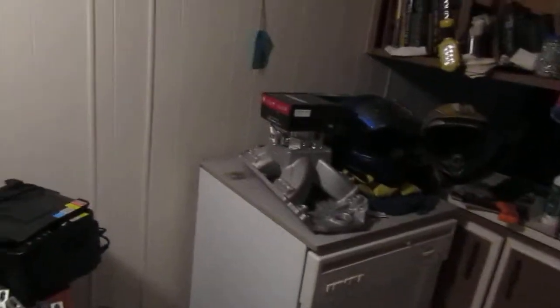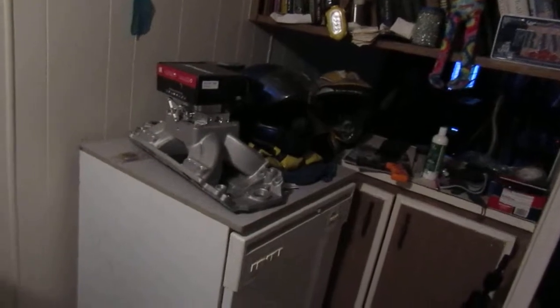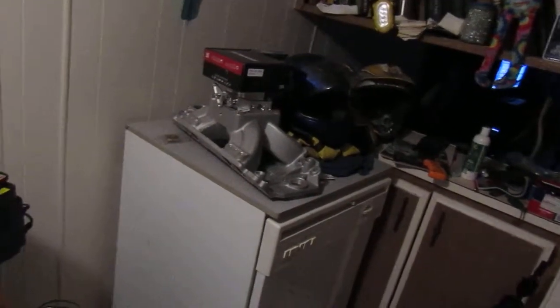So that's going to be, because this is a 1200 CFM throttle body, and the fuel injectors are good for 1100 horsepower. So once I get this fuel injection on there, man, I can't get the damn carburetor tuned, because I got this monster cam in it, and the carburetor hates the cam. It doesn't have enough vacuum at idle to run the carburetor properly. So that's why I'm going to fuel injection, and then maybe I might turbo it or something later if I have the money. But, you know, money's a little tight.